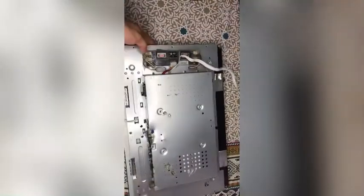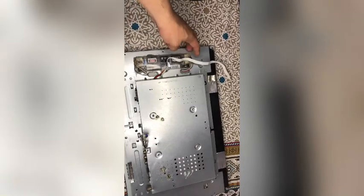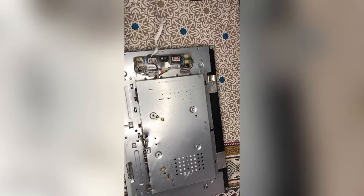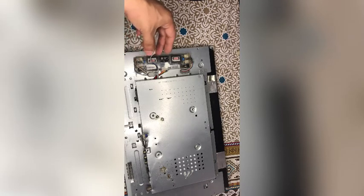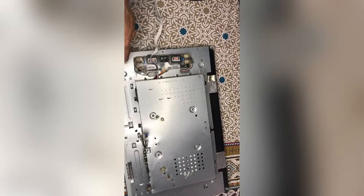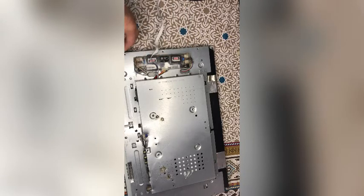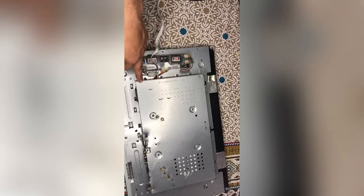I have put hot glue on the tube lights for protection. You should know that the CCFL inverter skin voltage is very high tension. If you touch it, it can give you a very bad current shock — similar to the flyback transformer in CRT TVs. For LCDs, the inverter voltage is very dangerous because it is high AC voltage and high tension. So be very careful about any leakage — high tension can reach your full body.